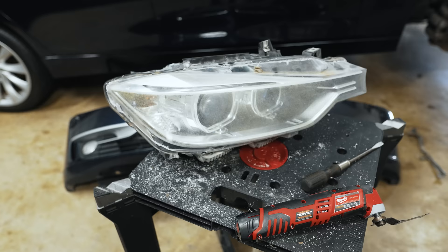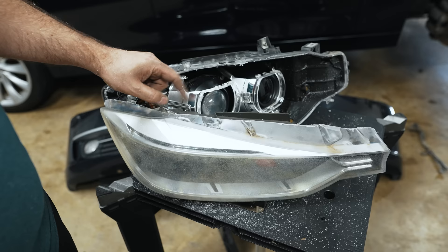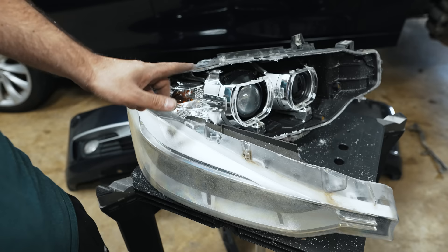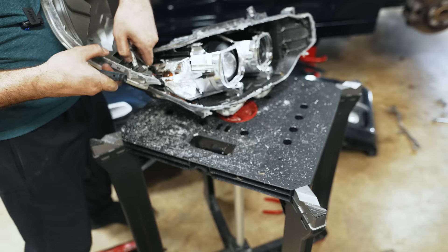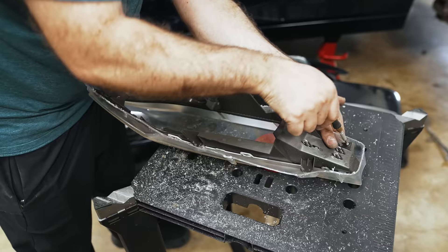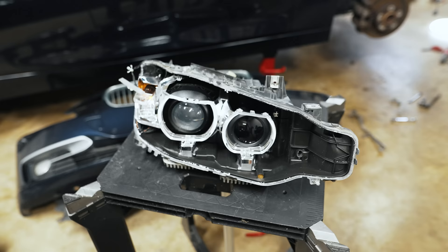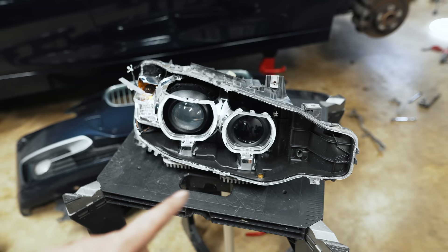All right, let's see if I completely destroyed this headlight. I couldn't have gone any deeper wherever I did it, so I guess I got this right. But you really have to be careful — never ever touch this with your fingers because it'll rub right off. Don't ever touch the chrome inside your headlights; even just rubbing it will smudge it permanently. Only blow it off. I used my T10 and got close to these black wires but they survived. Again, don't make contact with the chrome on these pieces — you'll really regret it.